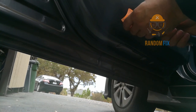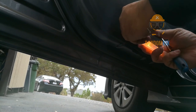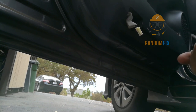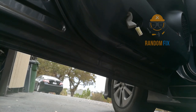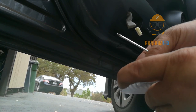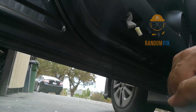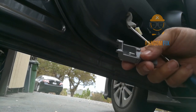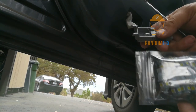For the door, I just put the screwdriver here and it pops out like that. I'm going to go ahead and hold the clip out of here. Now I'm actually able to go and change the light in this little fixture, which is going to be pretty easy. Here's the light fixture — to get this out, all you do is just pull it back. I've done thousands of these but for this particular one it just popped out like that. And this is the same light bulb that we had earlier — I'll have a link to them.